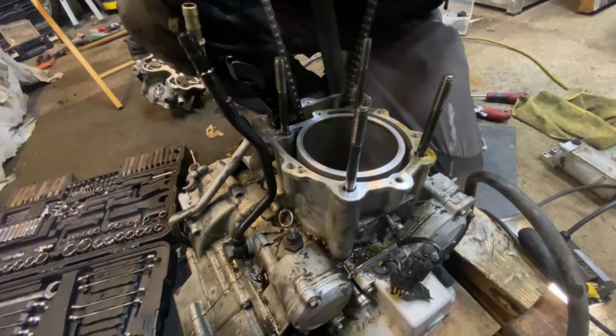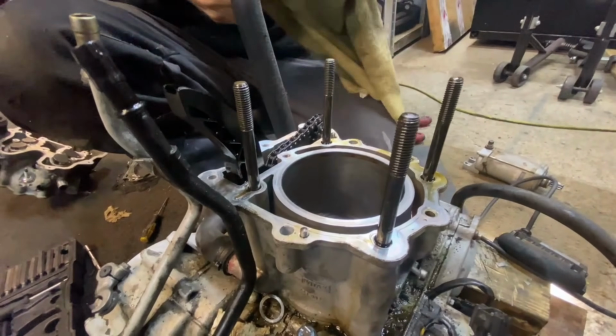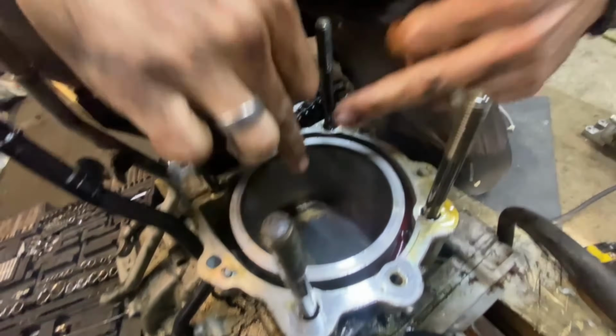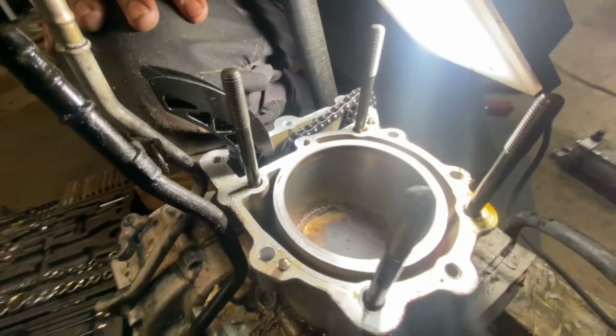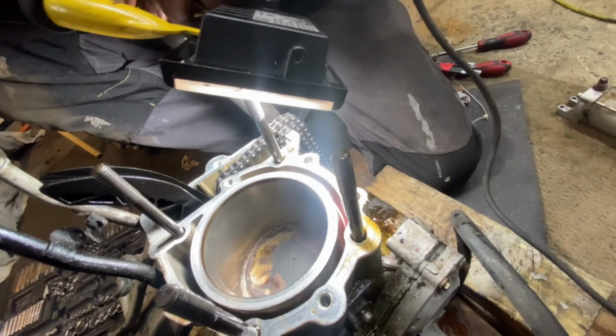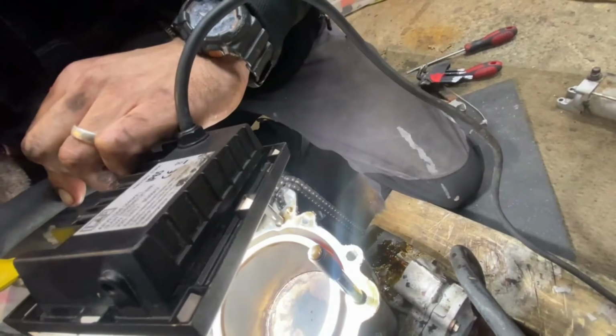It's all looking okay. These are also plated barrels, by the way, when BMW built these for a longer life engine, guys. You see all those scratches that are crossing around the cylinder wall. I don't know if you can see that. Maybe I'll put a light on there. That's cross hatching, and this engine doesn't look like it's done 10,000 miles in its life, let alone 45.